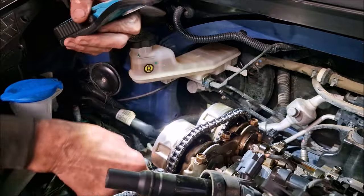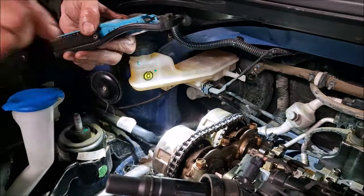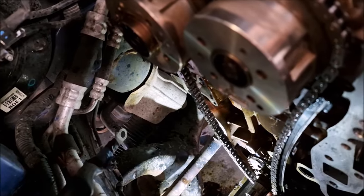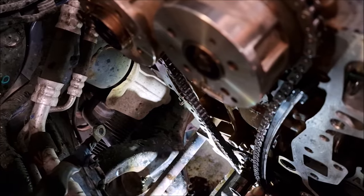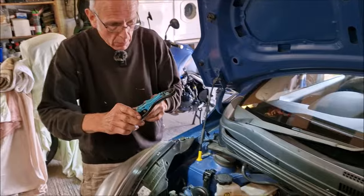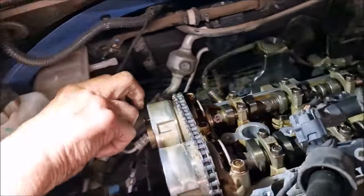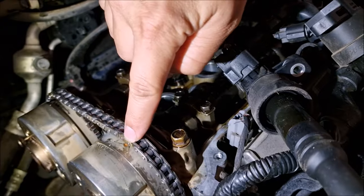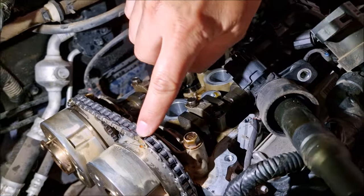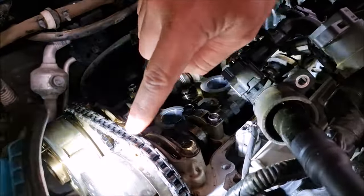That's a mark there, mark there. So the chain is loosely hung on. Can you just explain to us the fitting coloured process? Coloured links to the marks, mate. So let's have a look. So on here is a coloured link. A coloured link is sort of a goldy colour. And you can see here is the markings on the top here, and you've aligned them up.